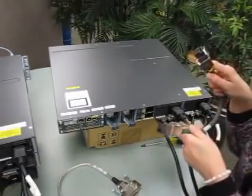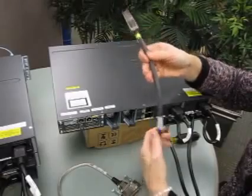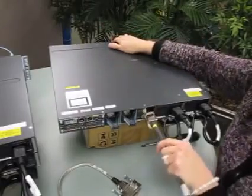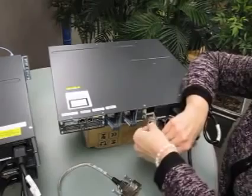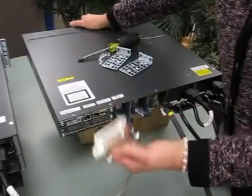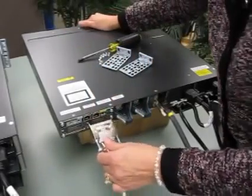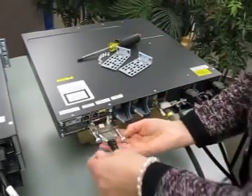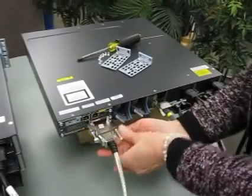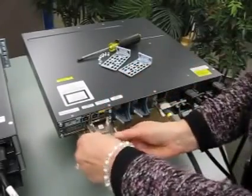Our next step is the actual power stack cables themselves. There is no difference between the ends, but if you look there is a color code. One side is yellow and one side is green. The reason that's important is you have to make sure that you match yellow to green and green to yellow. That's how the stack works. So we plug that in and screw these in place. I picked the bottom one to start with so remember that's yellow. The next cable to install is the actual switch stacking cable itself. If you look at it closely it actually matches the picture on the back of the switch, the shape of the interface itself. So we'll just get that pushed into place and we'll screw those in. Hold that steady because it's really difficult if it's not straight on. Do a little bit on both sides at a time and then they'll go in nice and square. Start with port 2 and then you'll be set to go.